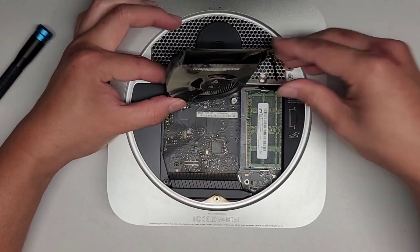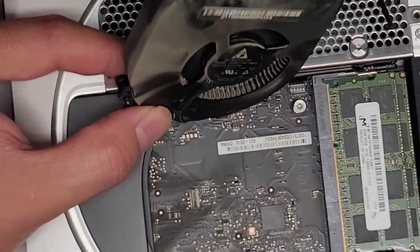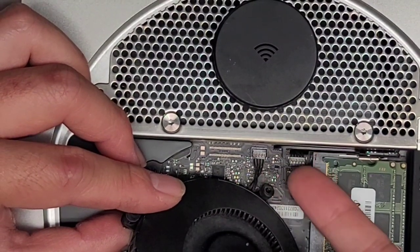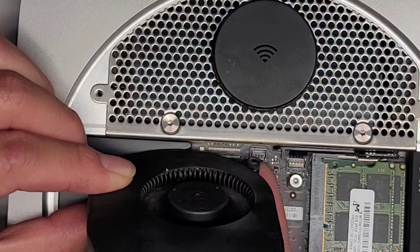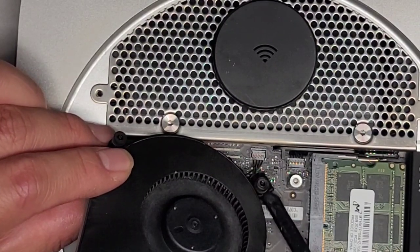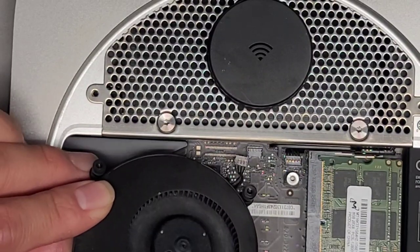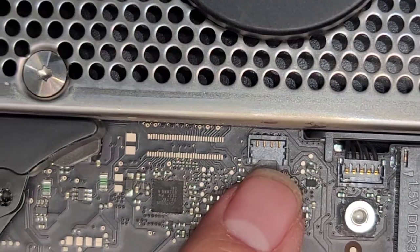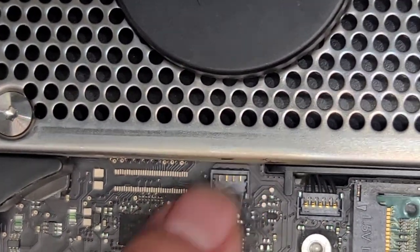You can see all that fine powdered smoke dust. This kind of connector can be a little bit tricky. You want to get underneath the connector and then pop it up, but you don't want to go too far that you end up prying off the part that's on the motherboard itself. I use my fingernail or a plastic tool. Use the corner to get under the center of it, and then twist it to pop it up. The connector here has a little groove — that's where we're getting the tool into that groove and popping it up from the center. You don't want to pry up from the side corners.